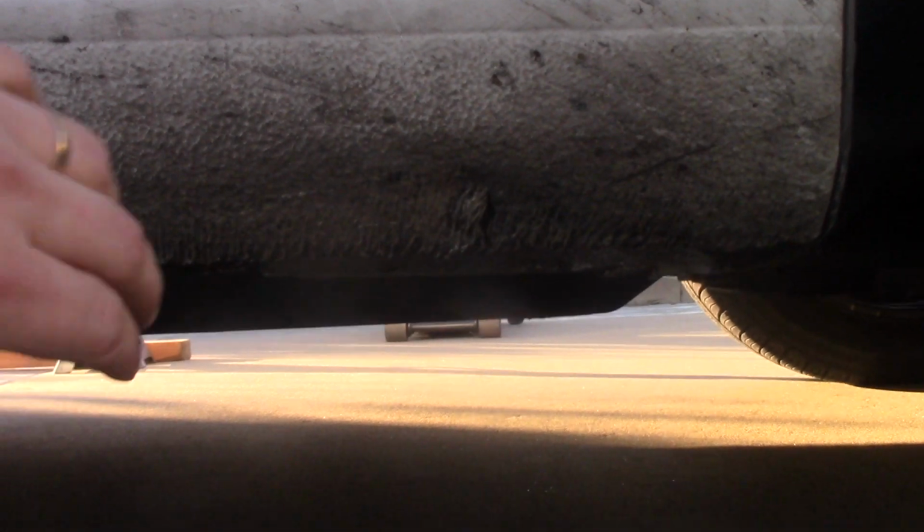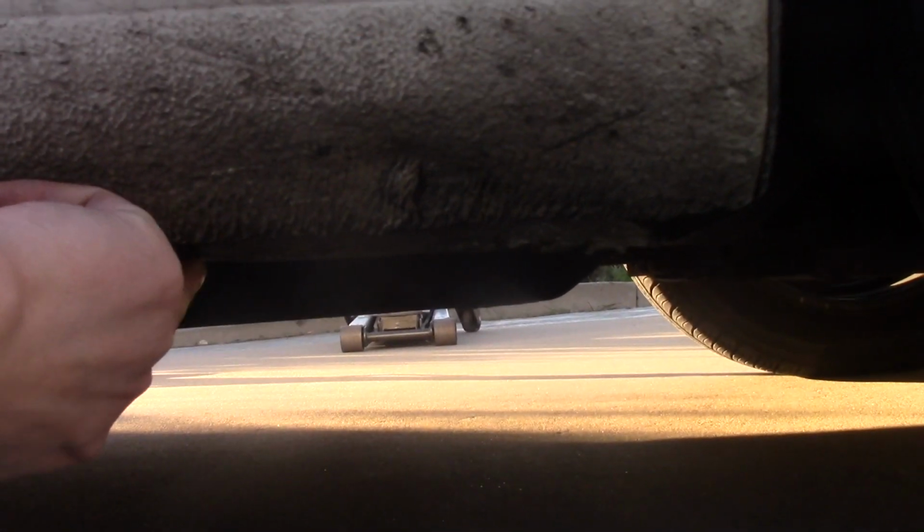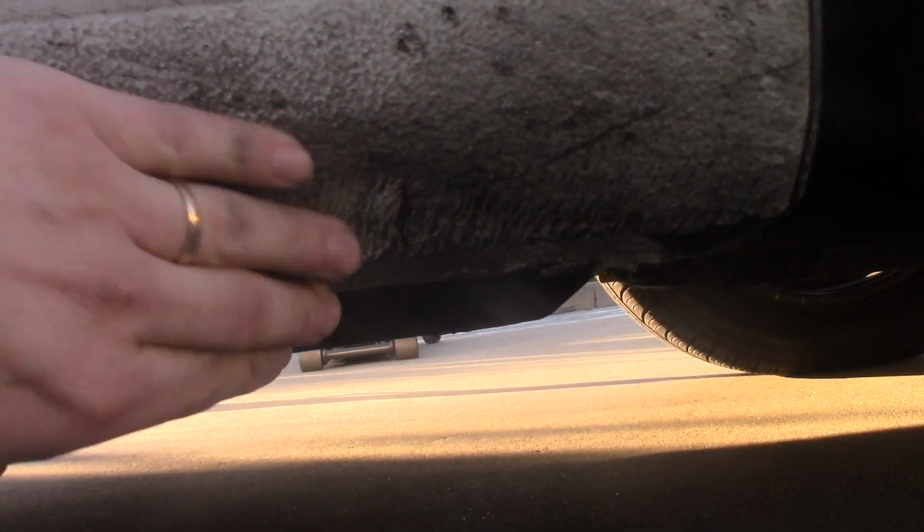And this car has always been serviced in some shops, maybe 10 different shops. As you can see, the guys bent the plate and didn't use this. I guess they didn't know where the appropriate lifting points are. You see it's bent. I'll try to add some light. You see this bent plate? Instead of using this double welded plate, they were using this one and bent it. So there's another reason why I'd like to do it myself. Even though I'm not a mechanic, I trust myself, and I will do my best to do the job. And you'll see that in a second.